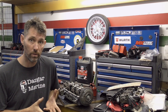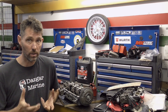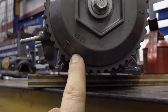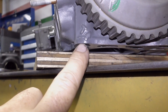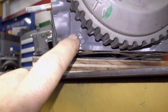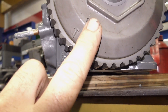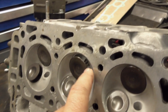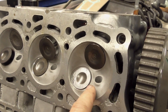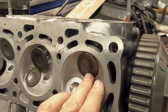The other thing to know is that Hondas turn counterclockwise — well this particular one does anyway — which is not quite as common as motors turning clockwise. You'll see here there's a T and an arrow — this is cylinder one, then cylinder two and cylinder three. On the cylinder block down here you can see the mark that we line it up with. As long as T and this arrow are lined up with T and this arrow, we know that cylinder one is at top dead centre. Flipping it over, we can see the exhaust port is open on cylinder three, the intake port is open on cylinder two, and both valves are closed on cylinder one — so cylinder one is at top dead centre of its compression stroke.